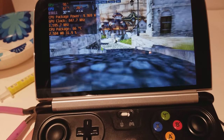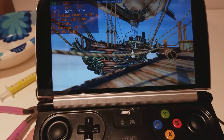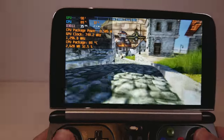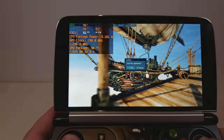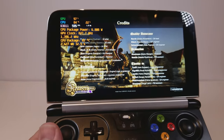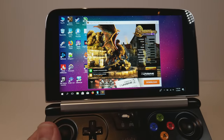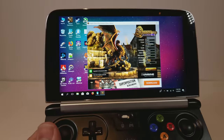The benchmark just started and we're up to 67 degrees Celsius — not too bad. Let's see what it looks like after 30 minutes. So as you can see, my temps have gotten worse — about five to six degrees Celsius worse overall. The paste job came out okay, but I think I might try a new paste, or I almost feel like I should use something that works as an epoxy to clamp it down, because I don't like that I'm missing that one screw.